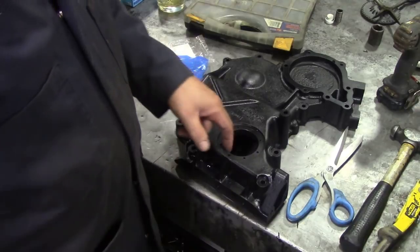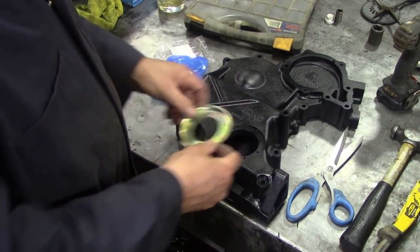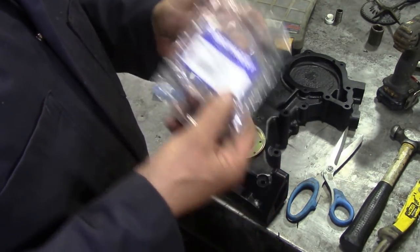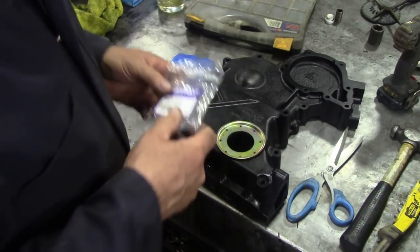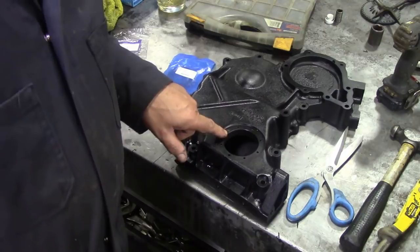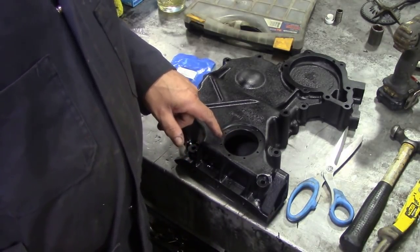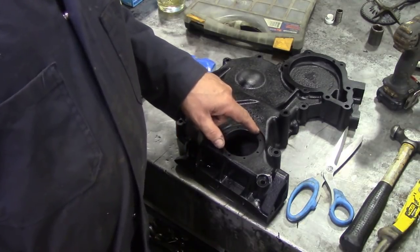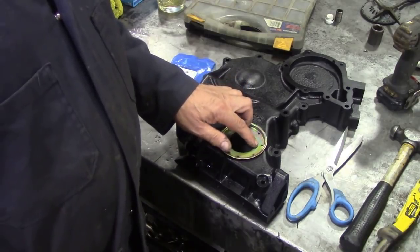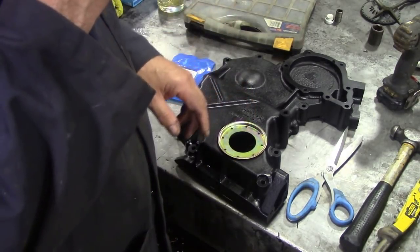I don't know if it does anything, but it provides a shoulder for the seal. But unfortunately there's no shoulder on the inside, so there's nothing to stop the seal popping inside. But they said it's what do they call it? Mud excluder. Well, I don't know about that. But anyway, what the problem is, this seal has been replaced before, and what you had to do was drill out the rivets that were holding that shield in here. It was held in by not pop rivets, but hammer over rivets, from both sides.